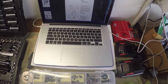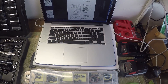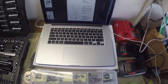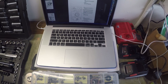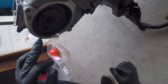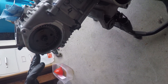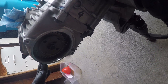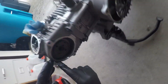Turn the primary fixed sheave counterclockwise. When the piston is at top dead center on the compression stroke, align mark C on the camshaft sprocket with mark D on the cylinder. Here's that mark — so that's aligned over here.